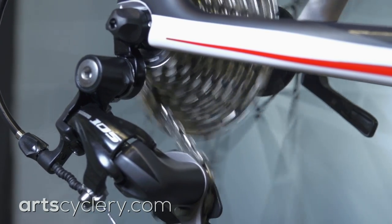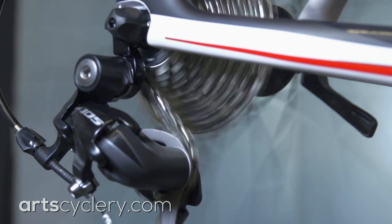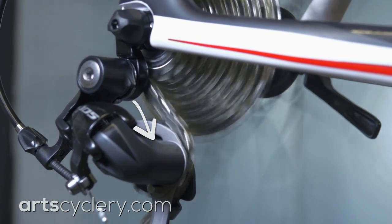I also have a bit of warning for you. There are sacrifices to be made when using a big cassette with the wrong derailleur. Using excessive B-tension to make the rear derailleur clear a cog larger than intended will move the derailleur further from your smaller cogs than it should be. The greater distance will mean slower shifts, more chain and cassette wear, and a greater likelihood that the chain will skip over the top of the cog's teeth under hard efforts. If you're unwilling to live with these sacrifices, you'll need another solution.